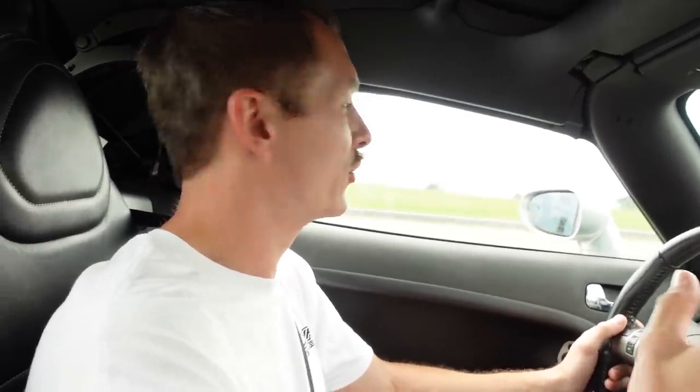We are going to pick up the Turbo S today — I'm super excited. There's been a lot of comments asking what's been going on with my mom's car. Once we got the AC working, it started having overheating issues. We narrowed it down to not having enough fan — just sitting idling with AC on, it would get hot. Once we got it running cool at idle, we realized it had ducting issues. The original ducting was removed when we did the turbo kit because we had to make room for the intercooler, so we just had to make our own ducting. Plus the race fans now on the car — it's running about 20 degrees cooler than before. I wanted it super sorted before giving it back to my mom so I could be 100% confident in it.